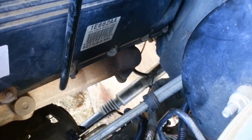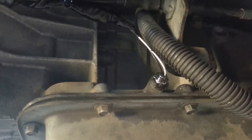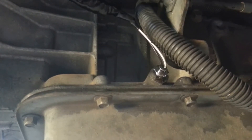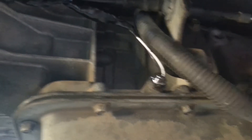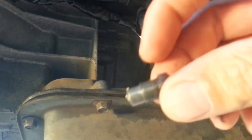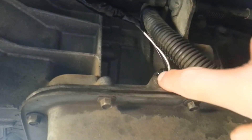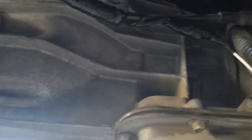I've got one wire that goes into the transmission, one going into the water jacket on the side of the engine, and I'm going to T-off the oil sending unit. The easiest one on this F-250 with the V10 is the transmission — it has a test port right on the side. You just pull that plug out, put some Teflon tape on the new one, and thread it right back in there.